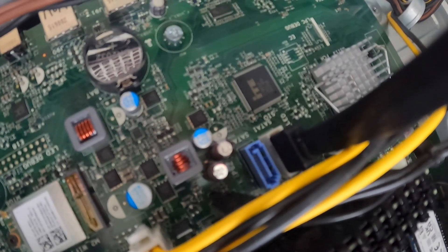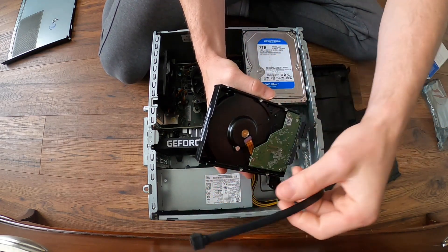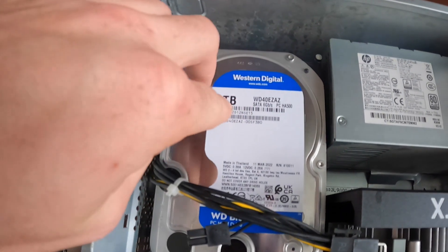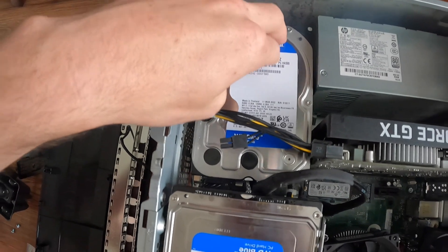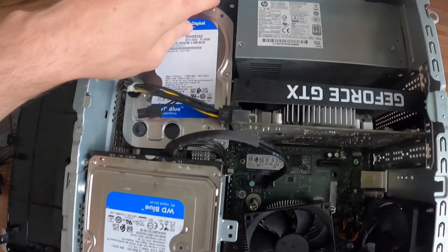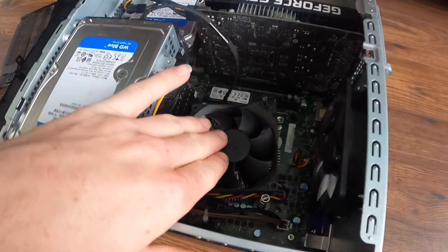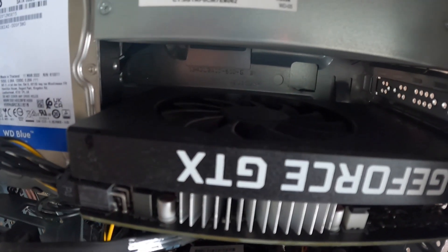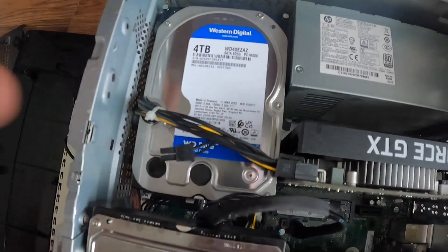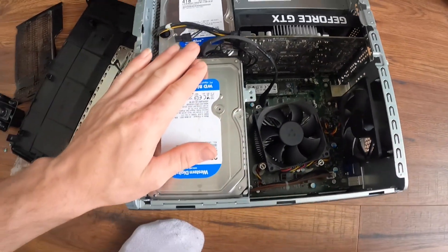All we did was plug in our extra SATA cable to the extra port. Now I'm just trying to find a place where I can actually fit my second hard drive. The best place I found to mount my new hard drive is right here, and my old one will still be able to fit right here — this one I have mounted too so it's not just flapping around. I'm not 100% sure this is the best spot, it's going to depend on your computer. I definitely didn't want it sitting over top of this fan, and I didn't want to slide it in here because my graphics card has a fan right there too. This is just about the only spot I was going to be able to fit it inside my PC.